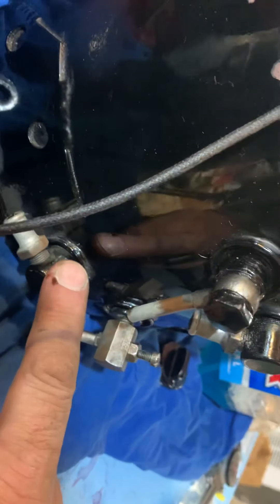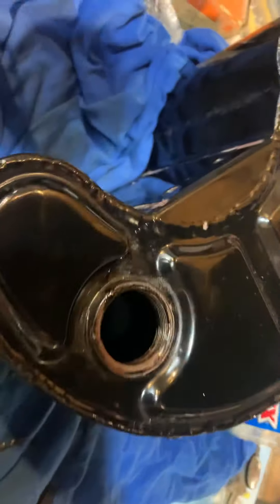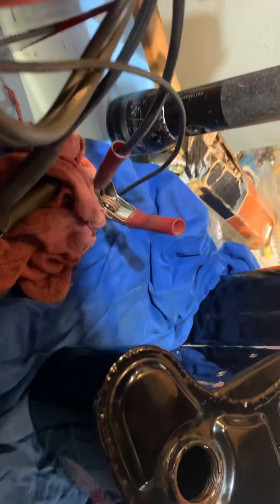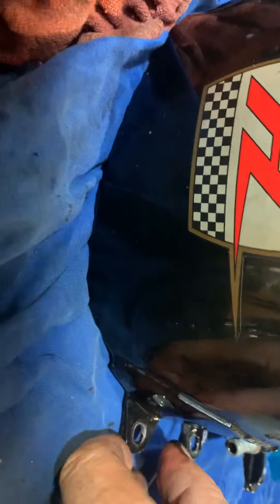You can't have the oil level over the top of this pickup tube, or else when you lean the bike on the kickstand it all drains out — that's why they say leave a little air space. This oil tank, because the pickup comes way over here, is fine if you're riding down the road or trail. But if you fall over on the primary side, this thing on an early tank — mid-'62 and earlier — is over here, so you could be in the air over on this side.